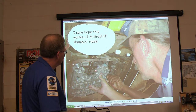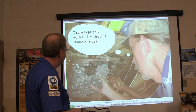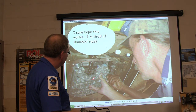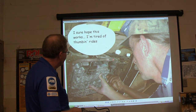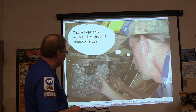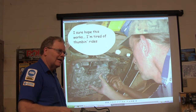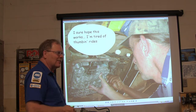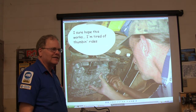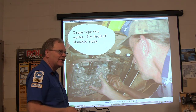This guy — Jerry Littlefield, one of my very first students — made a mistake on his pickup truck. While he was working on it, he pulled the dipstick tube out for some reason and some dirt got in the pan. That dirt was fine enough to get past the filter and into the valve body, and it wouldn't shift right. He had to clean that valve body about a dozen times to get all that dirt out of it.